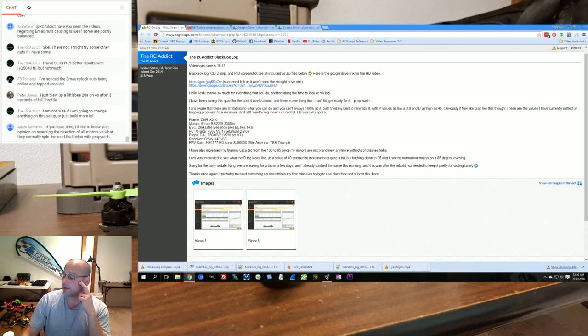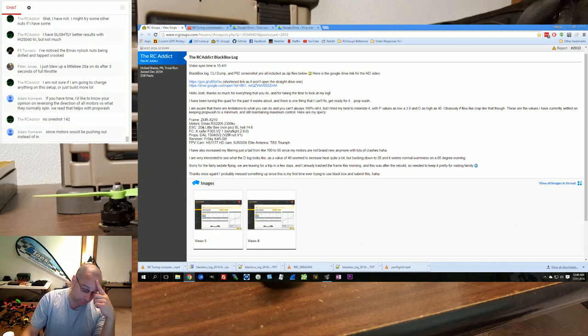If you're running Betaflight 2.9.0, then multi-shot has full resolution. There was a bug in earlier versions of Betaflight. I don't know if it was fixed in 2.8 or 2.9. I'm pretty sure the bug was there in 2.7, where multi-shot was not running at full resolution. So since you're on 2.9.0, try flashing multi-shot to these ESCs.